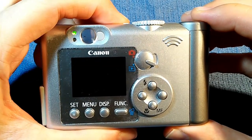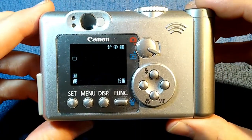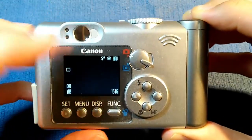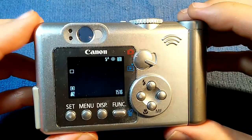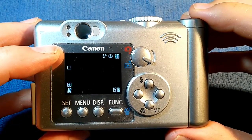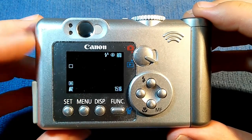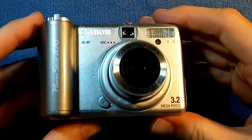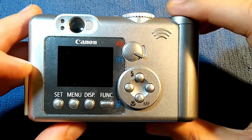When we hit the power button for the Canon A70, unfortunately we still have the same problem. Hit the display button — nothing. It's acting as if the CCD isn't seeing anything. It is possible that the replacement CCD I purchased is also bad, or the failure lies somewhere else in the camera. However, if you do own a Canon A70 and believe you have a CCD failure, this video does show you how to disassemble this camera, replace the CCD, and reassemble the camera.